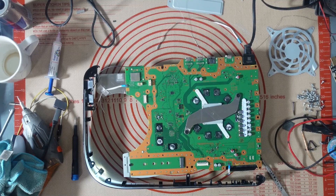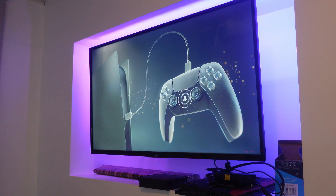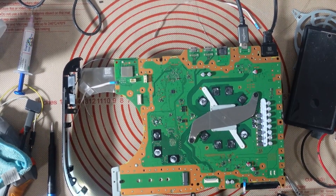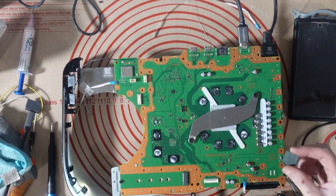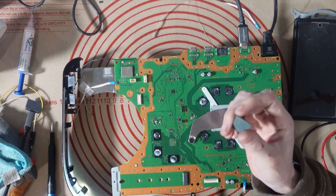That might be fixed — that might be a success. Not shutting down so far, that's looking promising. Plugging in HDMI and it's turning on and booting up — not shutting down. That is staying on and I'm going to take that as a freaking win. Obviously it needs a full stress test, it needs to get cleaned and put back together for that, but it was shutting down way before now. This board is now way hotter than it was when I had it inside the housing before I changed the SSD controller, and now it's staying on. I'm going to say that it very likely is another SSD controller issue. These things are failing like wildfire right now — this is like the fourth one I've had in less than two weeks.